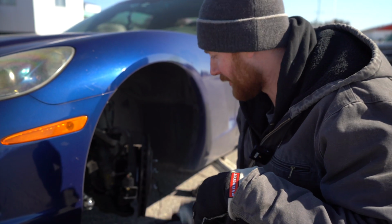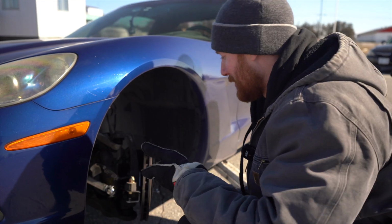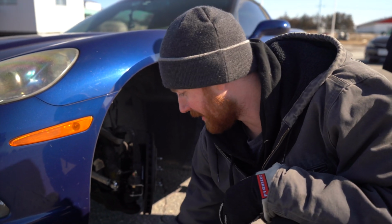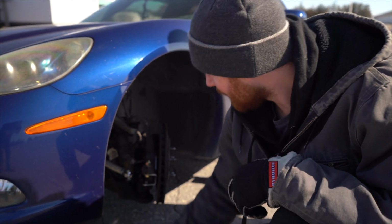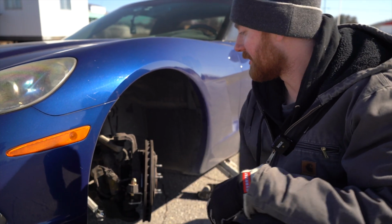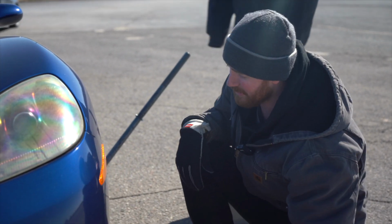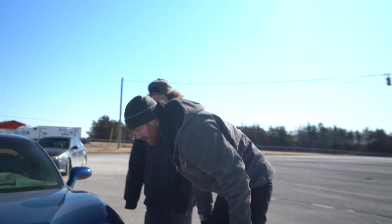We're gonna go to the factory location. Everything seems great. We're gonna switch her up and show you how it's done. Our little locking plate's doing its job, keeping everything from backing out. That's the bolt that was holding everything together. And there's your tie rod end, ready to go to its new position. Just like that, in a matter of less than 5 minutes, we now have the tie rod back in the factory position.